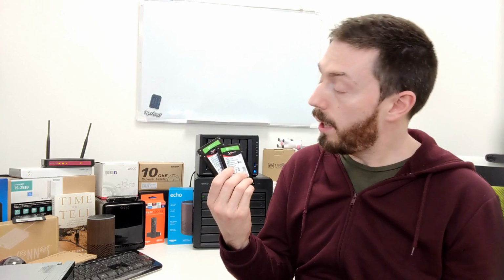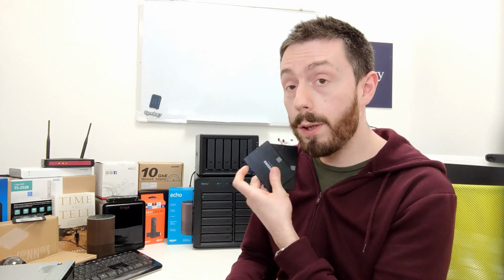We're going to do a cache environment with 2 SSDs. In one case, we're going to utilize these new Seagate drives. We're going to put these in a read-write cache environment to support that hard drive, and then do all of the same read-write internal operations that we did before. Now, my hope is, as previous tests have shown, that it will do them all a lot quicker thanks to SSD caching.